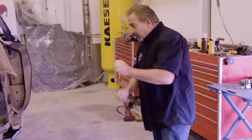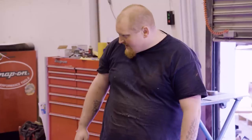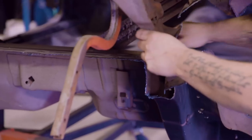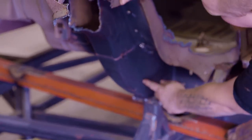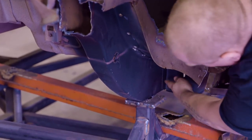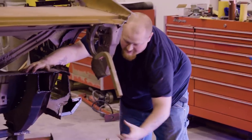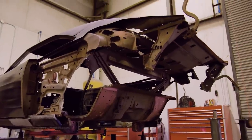All right. Well, with that, I'm going to go back up to my office and take care of some business. I'm going to start across this back panel here, removing this off of here, and then I'm going to go down through here and use the plasma cutter and trim this out slowly on both sides, kind of drop this apart from it, and then I'm going to jack it up and finish out the cut down through here, and then I'm gonna start prying this apart from this back panel to put the new frame rail sections in. It should go pretty fast.